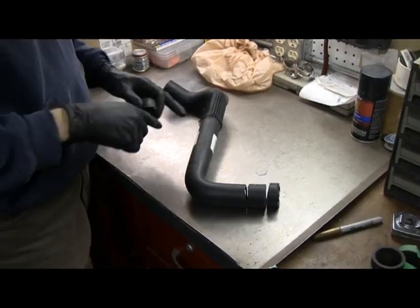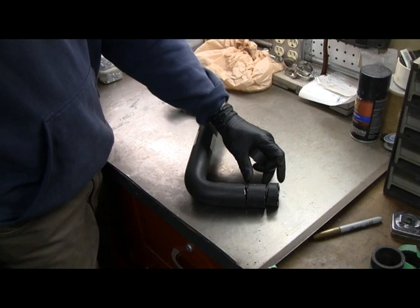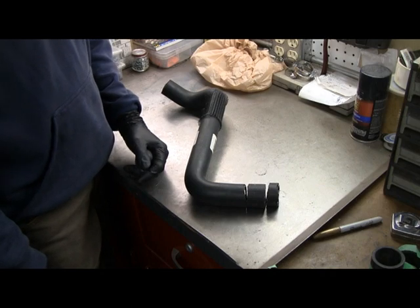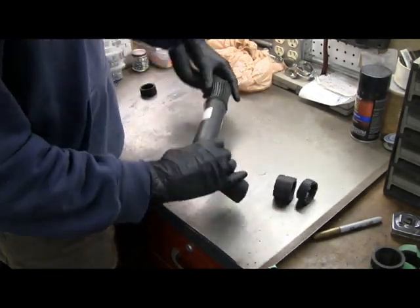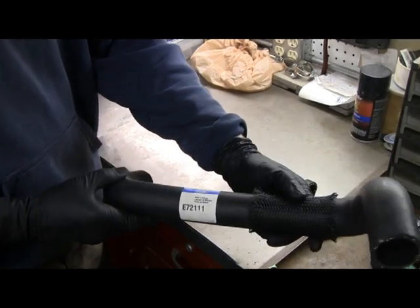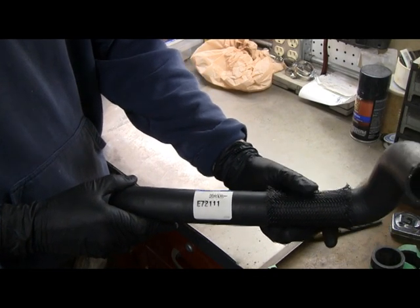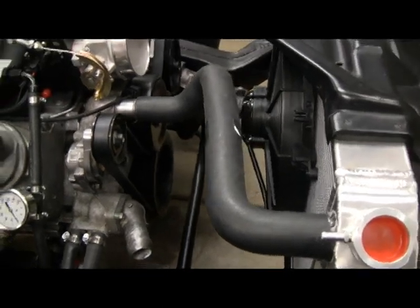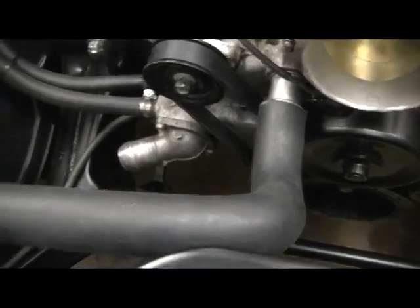The ticket for the upper hose was this one I purchased — I had to cut about two inches off one end, doing it in stages, measure twice cut once, and about three quarters of an inch off the other end. This hose is from Car Quest, it's a Dayco E72111. Everyone's application will be different, but this works for mine. There's the upper hose — it's got a little bit of an angle but overall it's good; put some clamps in there and it'll be good to go.